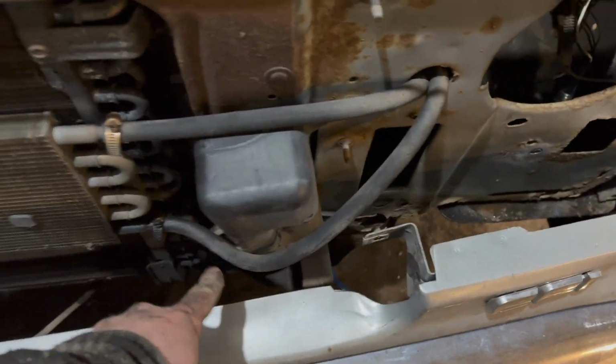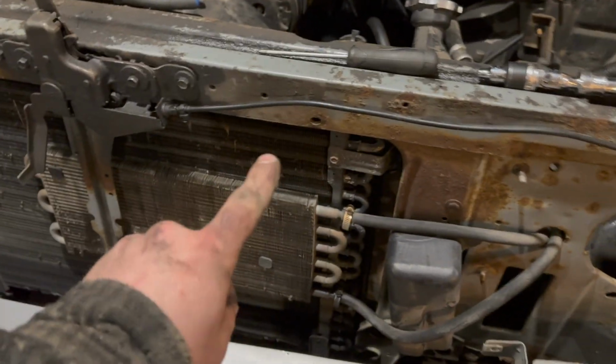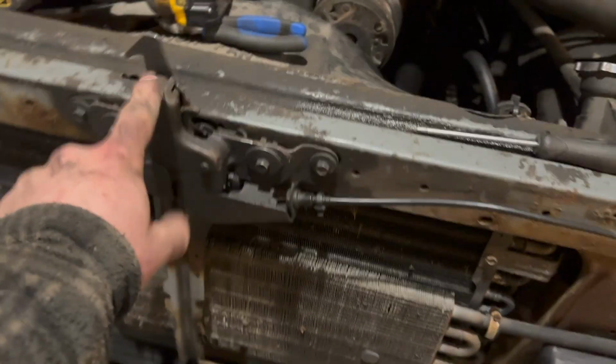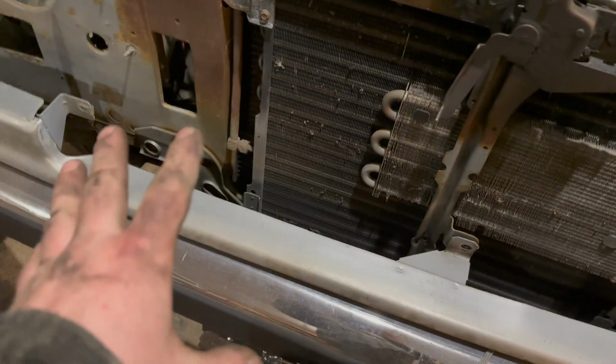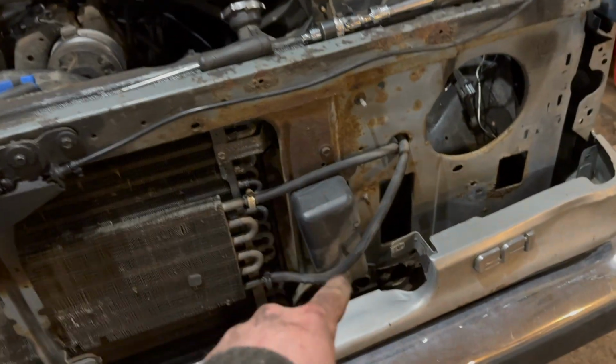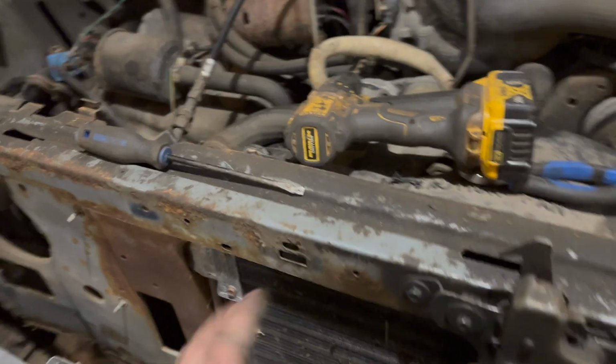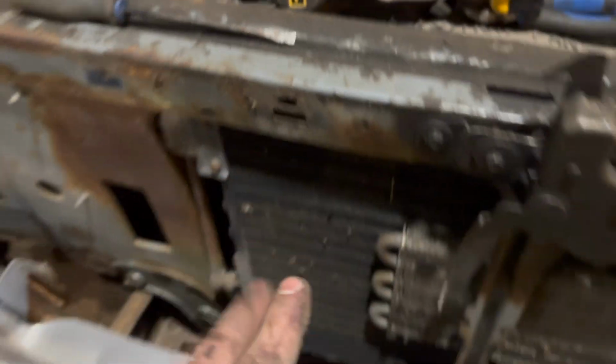That we can pretty much unbolt it from the bottom, but we got all this extra stuff on. Basically our coolant, our AC system, and then just the odd trinket here and there, like our hood latch cable, couple hoses, that kind of stuff. But in reality, the only thing holding it into the truck hardcore are the two mounts, and I'm pretty sure I can just lift the entire thing after. I don't even think I got to undo those because they're so rotten.